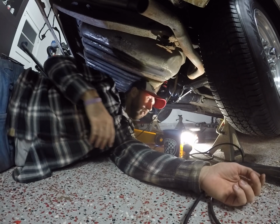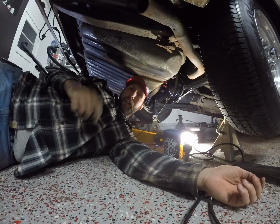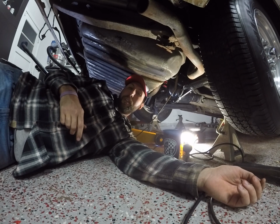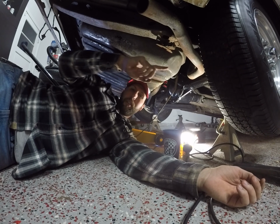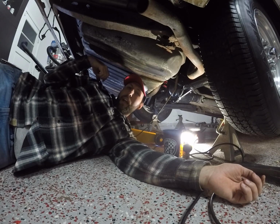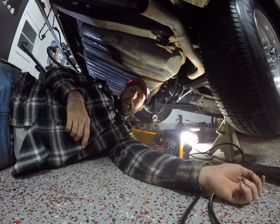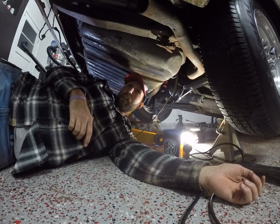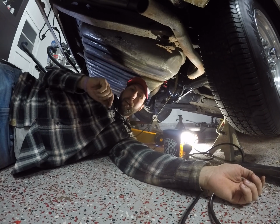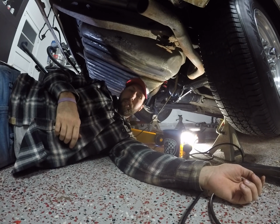and I don't know where it went, but anyway, there were like 6 barrel connectors and loose hose clamps, and I could definitely see it not holding pressure, therefore it probably wouldn't suck very good to the front. So I put a new piece of rubber hose in there. I was able to blow back through the tank, and then I sucked out about a gallon and went ahead and gulped it. So I'm going to leave this sit just like this, and I'm actually going to try to find a battery, and let's crank on it and see if we can get gas up to the old juice box in the front.